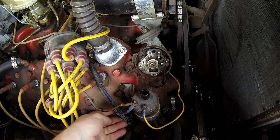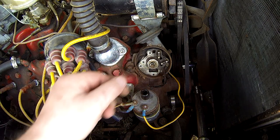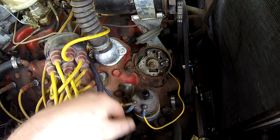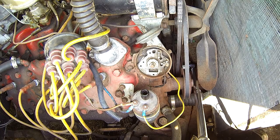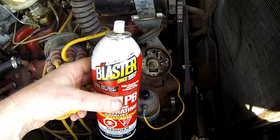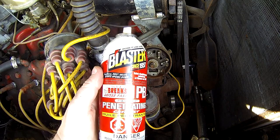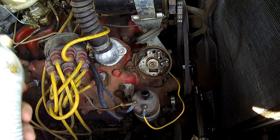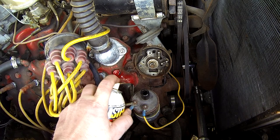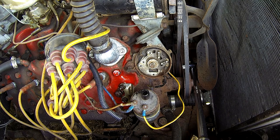I'm going to hit these two bolts that hold the coil bracket on, because as I mentioned there's just a screw and a nut holding the coil to the bracket and it's easy to lose that hardware. I'll take the whole bracket off and pull the wires out, but I want to hit it with some penetrant first. I'm not sponsored, but my favorite stuff is PB Blaster — kind of an as-seen-on-TV product but it's always treated me well. There are others; WD-40 has a penetrating oil version that's not normal WD-40. Anyway, let's soak those bolts down.